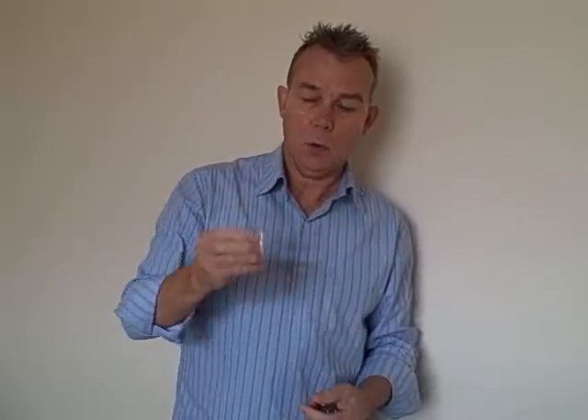They do clip in, just like other roof blinds that we have been talking about, but they use different clips. This is a side blind clip, and that is a roof blind clip. You can see that one is quite a lot smaller than the other. Basically that is because with the side blind, you do not need to hold the weight of the blind up. All you need to do is check that it is held in to the window, because the window itself supports the weight of the side blind. So they are a lot smaller, but they are clipped home in exactly the same way.